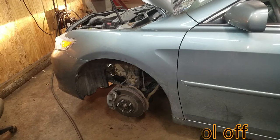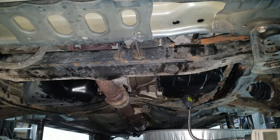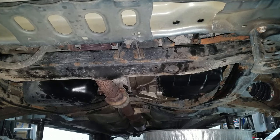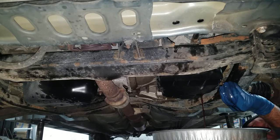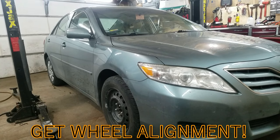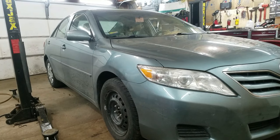Well, it seems like all the gears are working — I'm just going to let it run for a little bit. I had it in drive and reverse the whole time while it was on the lift just to make sure it's all good. I'm at 114 degrees transmission temperature so it's warm enough. Transmission's in park right now. Well, all things considered, this car seemed to go together pretty good. I think it's gonna be fine. Another job well done. Okay, bye.